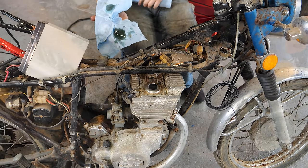This is the one that you hook right here to your vent, and then run down below the chassis so that when it charges normally and needs to vent air, because it's not a sealed case, it doesn't vent that acidic air onto your bike and rust it out.